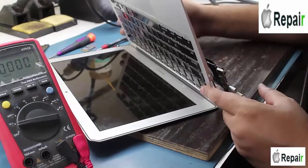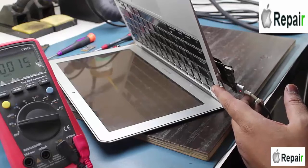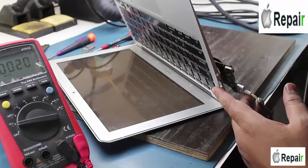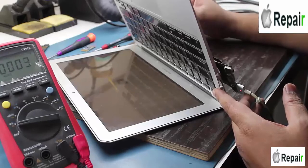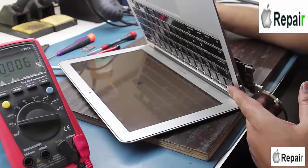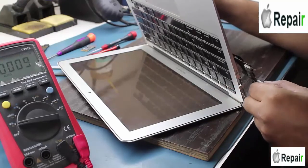See the display — just look at my power supply and I can tell that it must be displaying on the motherboard. Because when the amperage fluctuates as the display comes on, you know the display is working. If you are in the repair line you may have experience of this — when the amperage goes high it is done, and again goes high. Sometimes the display does not come and there might be a RAM problem, but most of the time the display comes when the amperage is fluctuating. Thank you for watching.